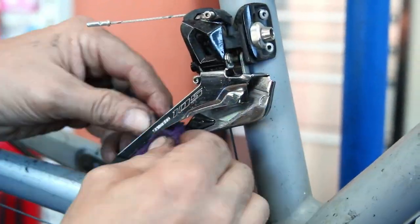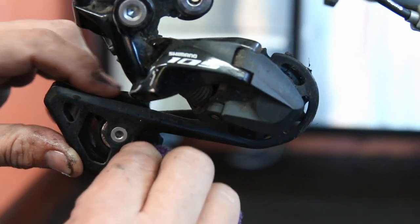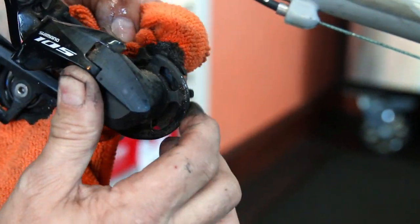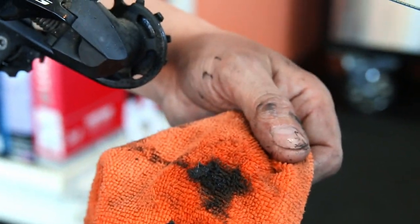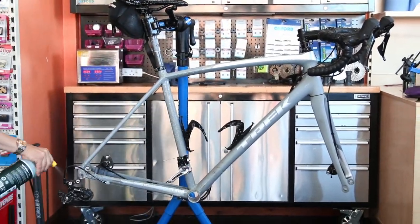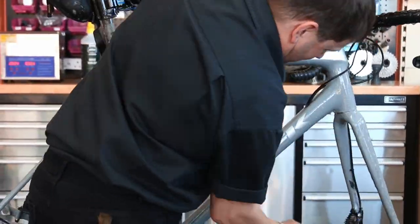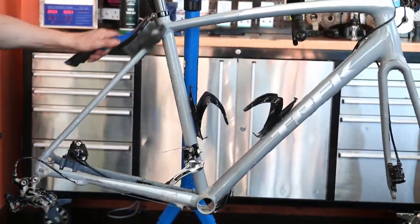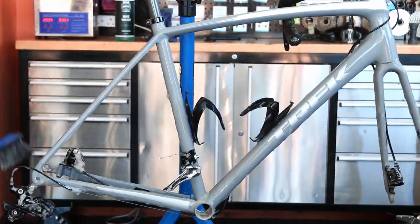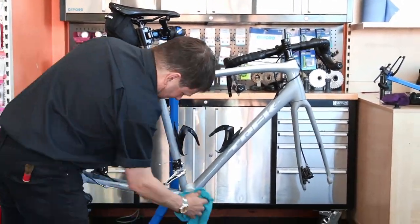While we had the degreaser out cleaning that shell, we just cleaned up the jockey wheels and the front derailleur — just give everything a little clean up on the bike. This isn't a full detail but you can see the thickness of that grease. It's all running around the chain and you're dragging it around with your pedalling — it just slows down the bike. A little bit of attention to detail and a little bit of service can make the world of difference to the way they ride.